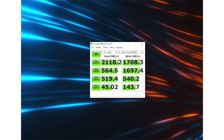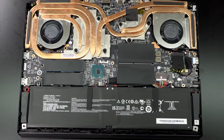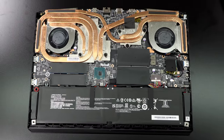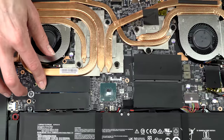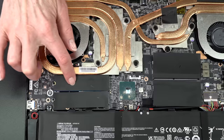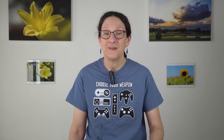It has two RAM slots - DDR4 3200MHz RAM, available with 16 or 32 gigs. It has two M.2 SSD slots; one comes populated and you can get with either a 512GB or one terabyte SSD. We have Intel Wi-Fi 6, the AX201 card, in addition to Intel Ethernet, and that's Bluetooth 5.1 on board as well.